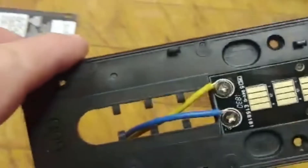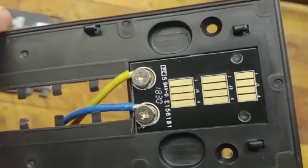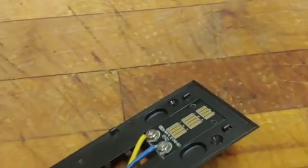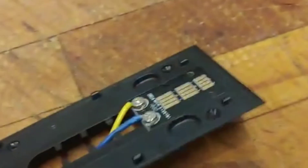Here's the back cover. Taking apart the Ring was pretty easy. I'll remove those test wires — I'm still going to run it on battery. There are screws in the back: two are hidden under a little cover, so four screws total on that cover. Then there are two screws right underneath, and two more — six tiny screws total. Two on the bottom are holding the mounting plate, and removing those gets the back cover off.